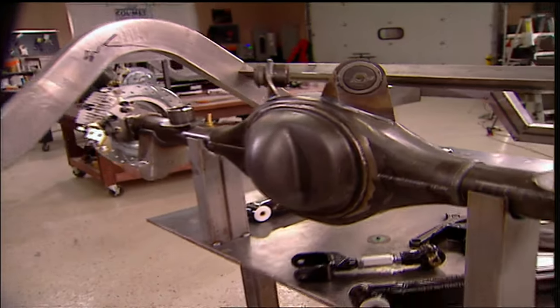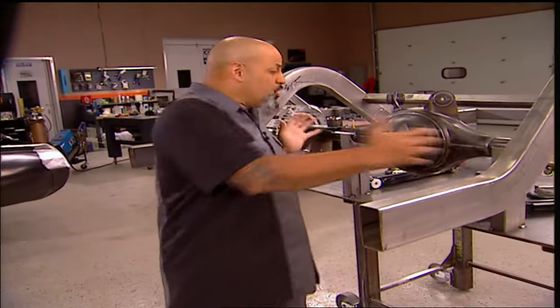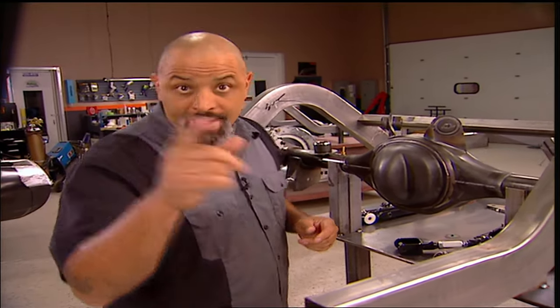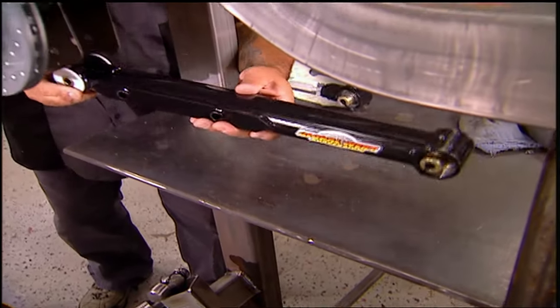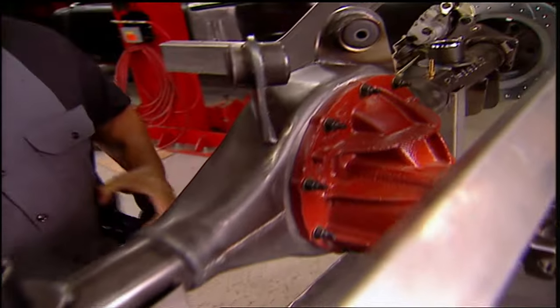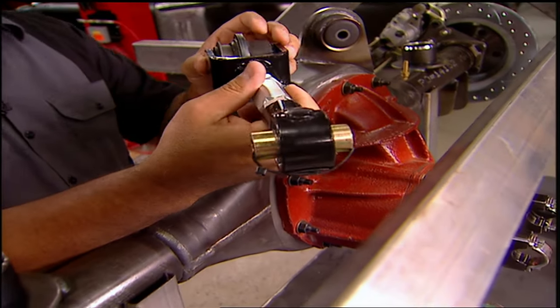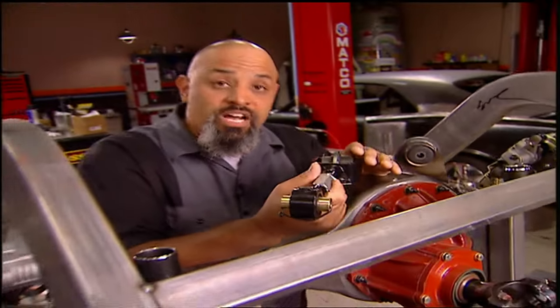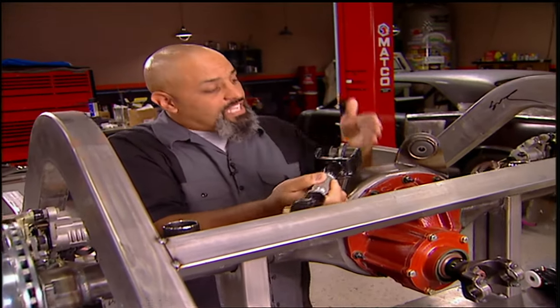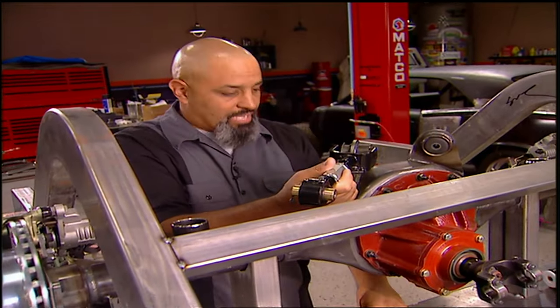Cars couldn't afford to lose all that space, because huge trunks and luxurious living quarters were top selling points, and a triangulated four bar made it possible. It too uses bottom bars, except much shorter. The panhard bar is replaced by two top bars running at an angle. Now you can see where geometry comes into play. With the proper lengths and the proper angles, it's designed to keep the axle travel as straight as possible.